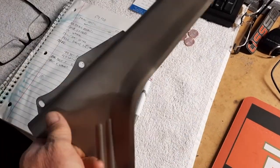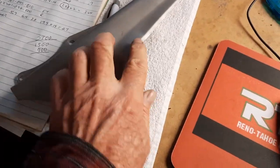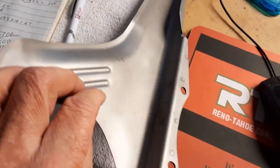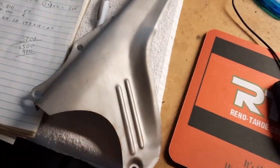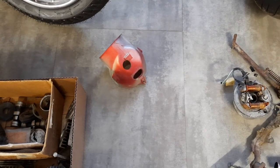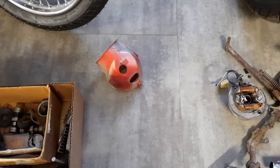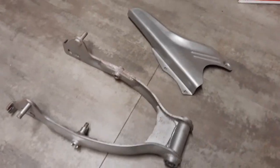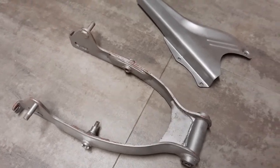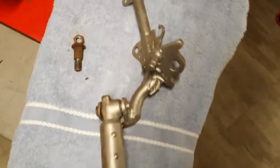This is my bead blaster. I'm going to take this - I think there's a little dent right here I'm going to straighten out - and then prep these things for paint. Getting this ready, that ready, the headlight bucket, and I've got one other part by the blaster I'm going to blast next. I'll just hit them with a little sandpaper here and there and then a coat of self-etching primer.